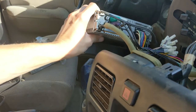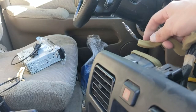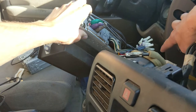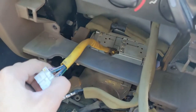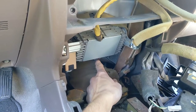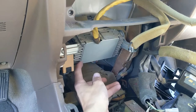For this demonstration, pretend that this is the stock radio. First, you'd want to unplug this, which is your radio antenna. Yours might also have this cable plugged into your stock radio — go ahead and unplug that too. As you can see, I have a wiring adapter harness here, but yours would actually just come right here — maybe a different plug with two plugs. Let's go ahead and disconnect it right here. One thing to note: this yellow cable goes to the factory amplifier. I'm not sure if all 4Runners of this year have an amplifier, but as you can see it just goes into this box here. That box has two clips that come out of the amplifier. To bypass it, I'm not going to use this cable at all. I'm actually going to remove the amplifier for extra space and unplug the two OEM plugs from the bottom of it.